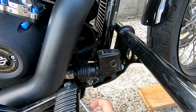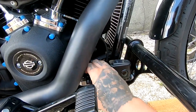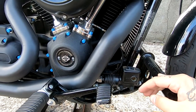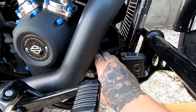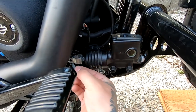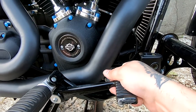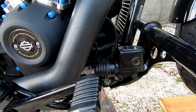I think it's pretty dangerous to have your rear brake so low. I really like having it up high so when you jam it down you have all that pressure. Anyway, that's a short video for today — clutch arm on one side, rear brake on the other. Now we're just putting it back together — throwing this pin back in to keep the brake in place. I'm still not sure if it's as high as I'd like, but it's a good inch higher than it was. Going level with the peg — that's a pretty good spot. Throw the pin in, tighten the nut, and we're good to go.